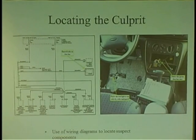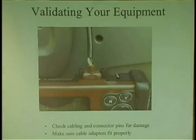A radio. A lot of the radios are all computerized now. Or go with something that lays low underneath carpets where there's moisture. Maybe the airbag took on some kind of moisture. You don't know, but you go for the most obvious things you see. And here, a guy put an aftermarket radio in that wasn't wired properly internally, and it actually put 12 volts on that data line and took everybody out. When he puts the radio in, the radio works fine, the car's working fine. It's when you go to inspection and they plug in, they say they can't communicate. So that problem was there since the radio got put in. I've seen this problem many, many times over. This wasn't the first time.